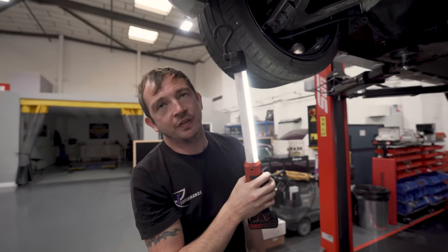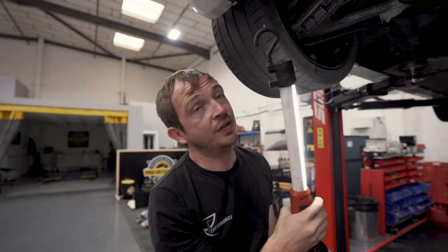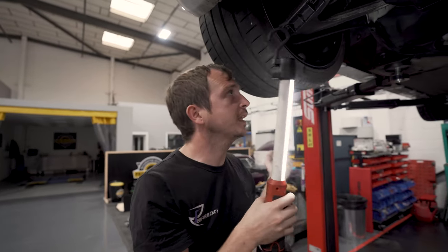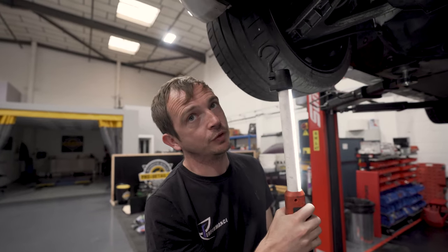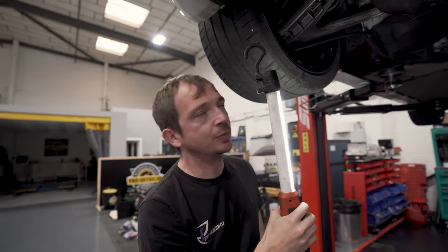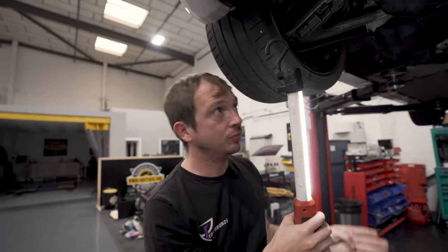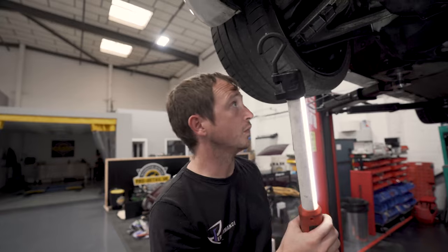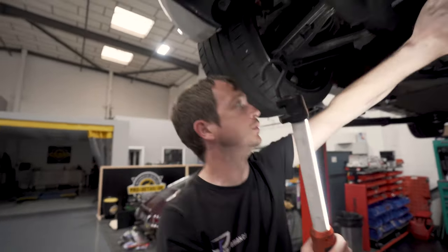They're about 350 quid a hose on V10s, and there's three of them. It is a bigger problem on the V10s and the V8s because the hoses are different on the V8s. So we probably do more V10s than we do V8s. But yeah, it's about 350 quid a hose, and there's three of them. On V10s, you've got to drain the oil out. So luckily in this instance, it was in for a service anyway. So yeah, if you're getting anyone to do it, get the covers taken off.